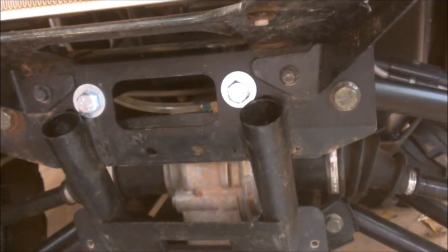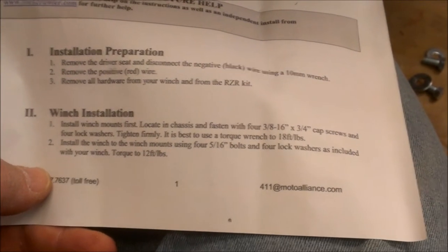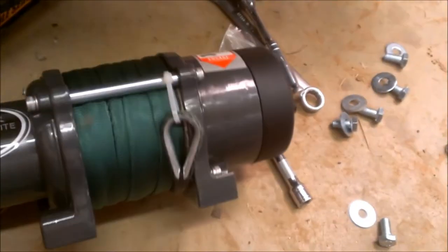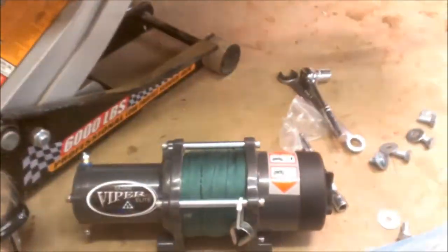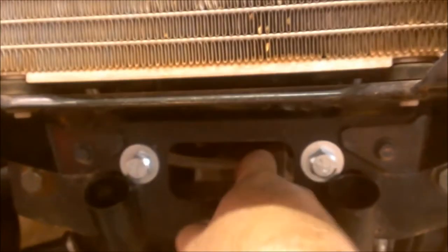Next step is to set the winch in there — again, not a whole lot of instructions, no diagrams. Here's the Viper 3,500 pound winch. I'm going to cut that cable off and coil out some synthetic rope. From what I've seen it should be mounted as it sits on the ground, so the synthetic rope is actually going to come off the bottom of this. There's a fair lead bracket with a little bolt to hold the fair lead, so the winch will be on top of the bars wrapping off the bottom.